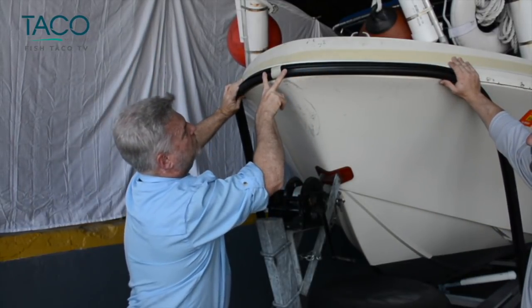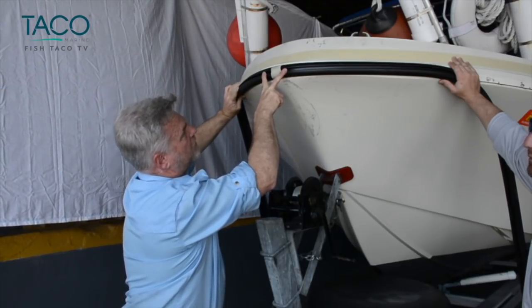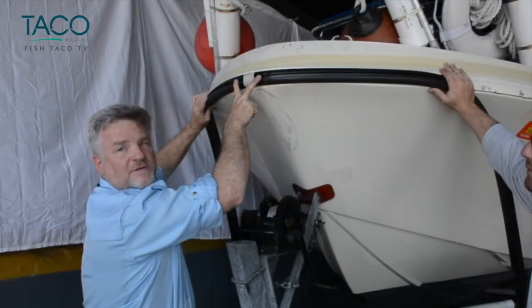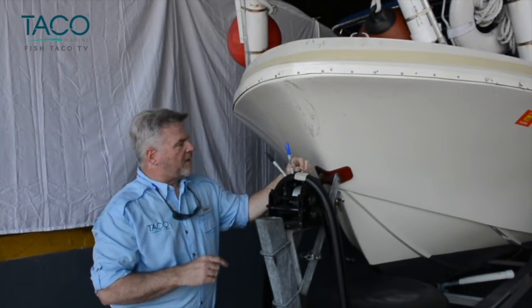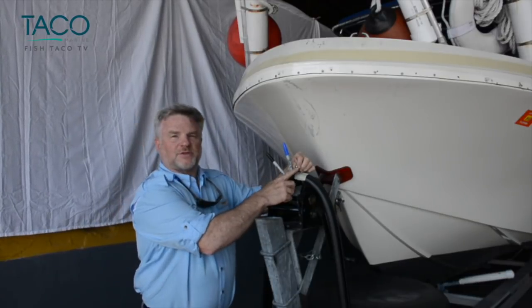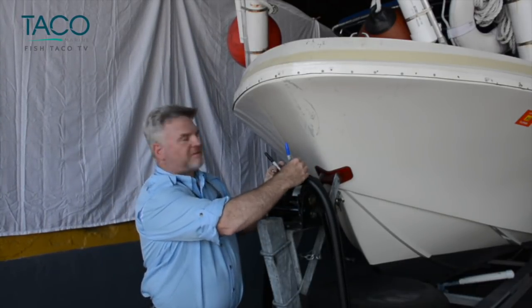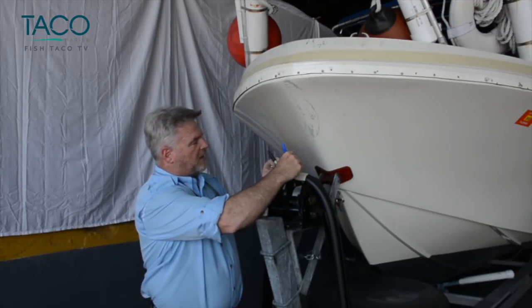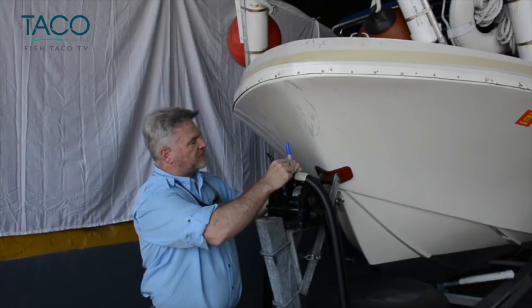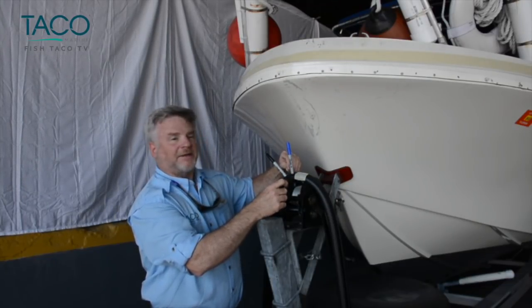And then we're going to anchor off the rub rail with a couple of screws right here on the sides of the center point. One really neat trick that I found over the years when installing rub rail is that sometimes the screw heads have a little bit of difficulty in clearance. So we've got a couple of magic markers or a couple of dowel rods, put them right in here. It opens it up a little bit so that the screw head fits in much easier when applying.